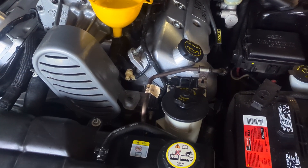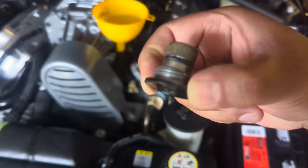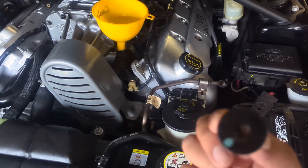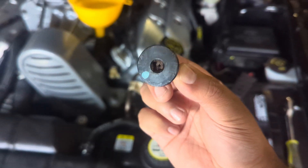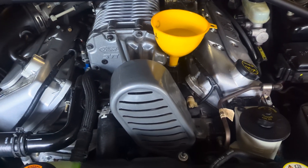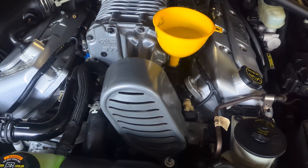A little quick tip: the plug that closes off the crossover tube — put some anti-seize on this because sometimes these get stuck in there. The anti-seize should help because they did a really poor job making this. You don't want to break off your socket in there and have a hard time getting it off. Some companies make aftermarket ones with like a little nut welded to the top — you can get that if you can find it.